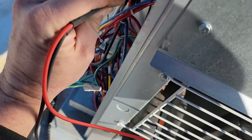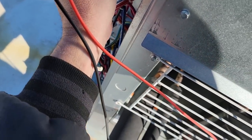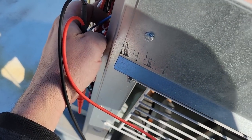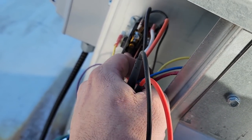Not so much on the bottom, and not so much on the top either. Let's do one leg to ground — I've got 120-something. Obviously the other leg's going to be the same thing because it's looping through the compressor. But you push that in and it doesn't run.